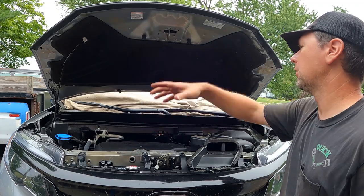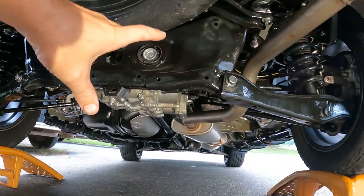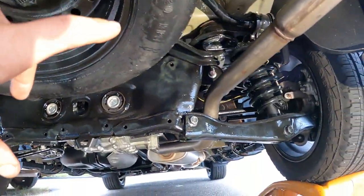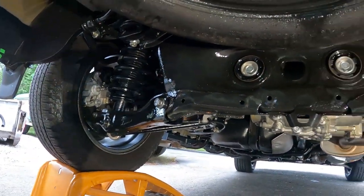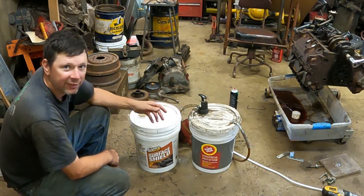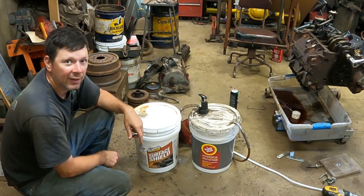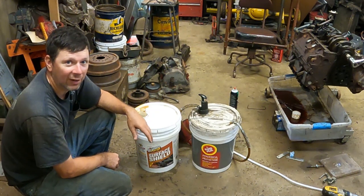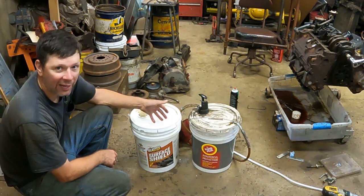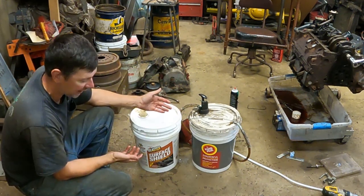After about an hour and a half of spraying, almost a gallon of Surface Shield later, the bottom of this Pilot is sprayed really nice — put on really thick and heavy, sprayed in all the frame holes, took the plugs out, got it up in everything above the spare, all over the place. You can see it pretty much coated the entire bottom of the car very liberally. Surface Shield really goes on fast and since it's very liquid you can get it in a lot of places, so it might actually penetrate even better than Fluid Film because it's going to travel more.